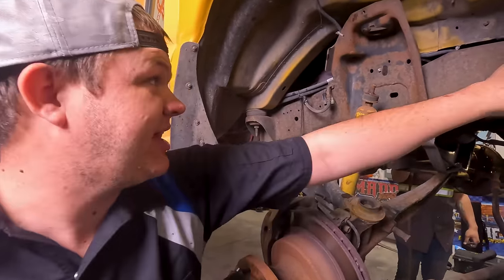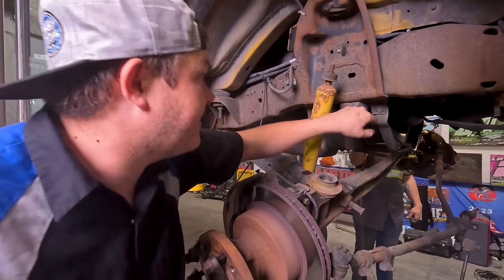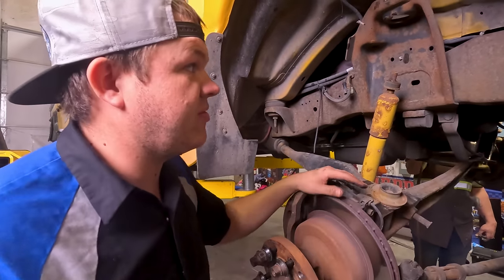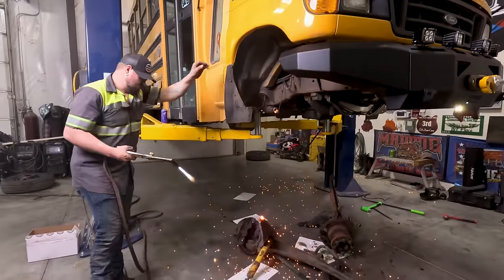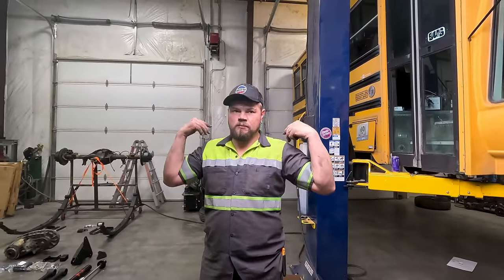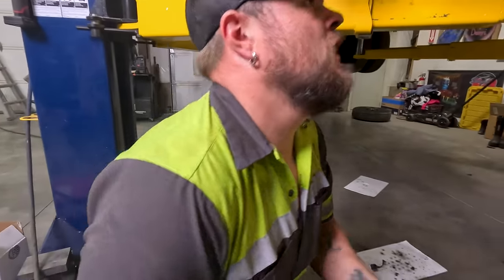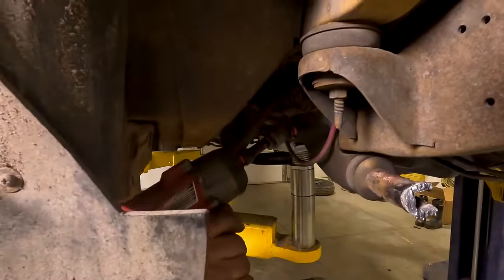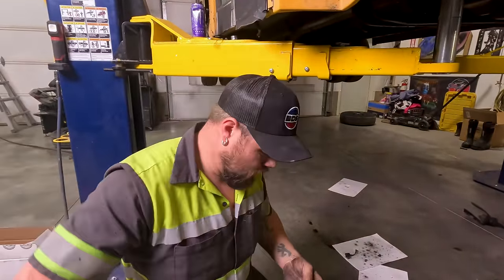The cool thing about this frame is it's literally like an I-beam. We are going to have to cut all of this weld. There are a couple of rivets that are going to have to be cut, and then the shock tower will come off the frame and we'll be able to bolt or weld that new one on. Now that we've got the front suspension all dropped out, the next step is to move to the rear axle and get the whole suspension and rear axle pulled out. I forgot a step — I've got to bolt three bolts on this side to drop this bracket out, and there's one on the other side, for the radius arms.